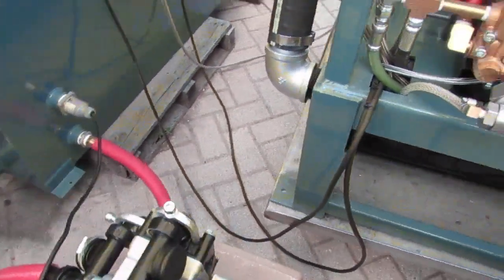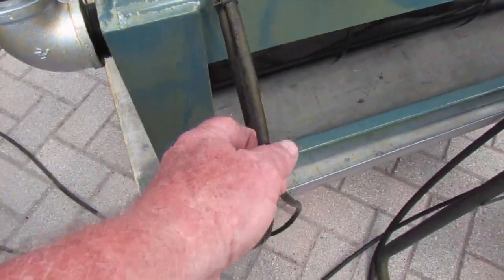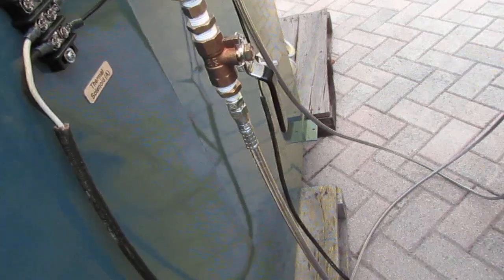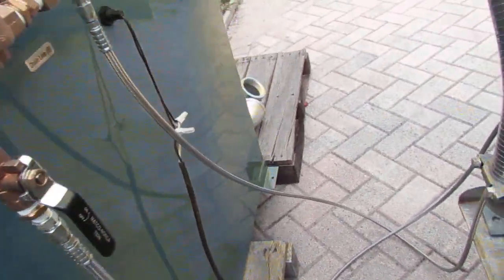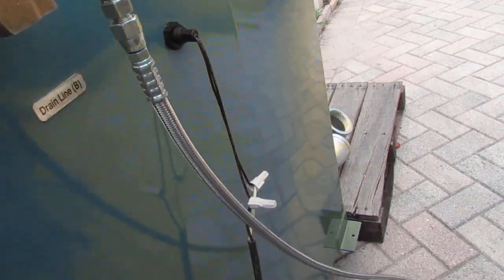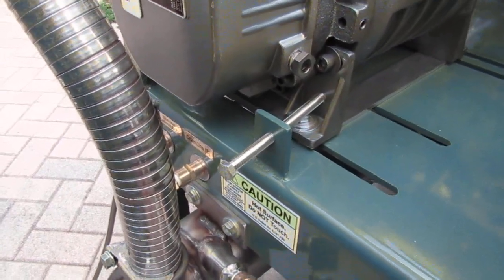As you can see, there are two lines that connect to your thermal line that turns on your solenoid for your dump — that's for your thermal dump. White goes on the top, black goes on the bottom. Your shutoff switch is non-polarity, so it doesn't matter which wire you hook up to. Each one of these stainless steel braided hoses is indicated by the thermal solenoid A as well as what's on the frame — they coincide to the same location.